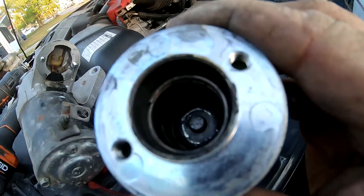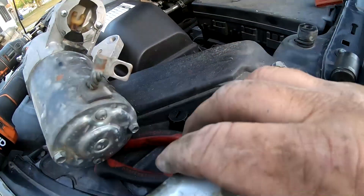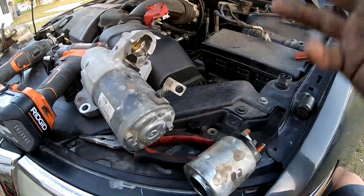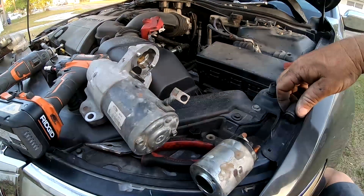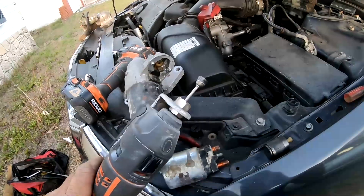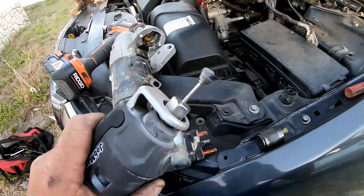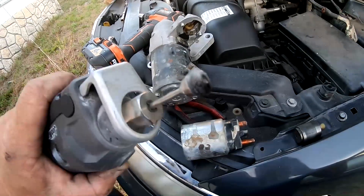This pin inside is going to be brand new clean, and that is actually the problem with this starter — it's not the starter itself. This is an old school kind of mechanics thing. I'm not a mechanic, but I've talked to mechanics and had crappy cars 30 years ago in high school. I'm going to use a rotary tool — basically a Dremel — with a cup brush bit attached, and I'm going to use that to go inside and clean it.